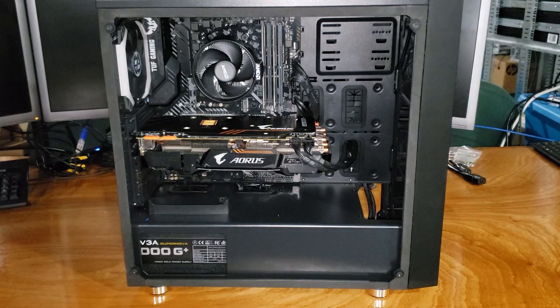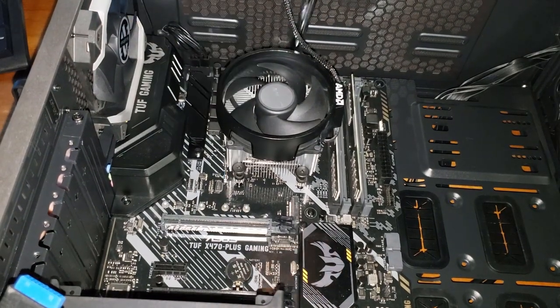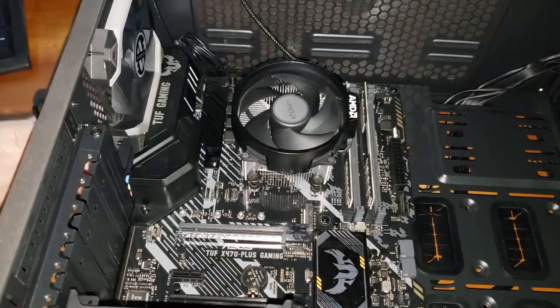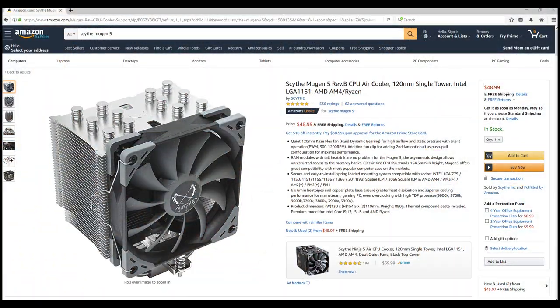I found the one included fan to be okay for overall system cooling, but probably not enough in a situation where the graphics card or processor has low-end coolers. I ran the first set of tests with my Ryzen 1600 AE at stock speeds with the stock cooler, landing around 74 to 77 degrees Celsius during a 3DMark Time Spy run. This is roughly where I'd expect temperatures to be, but slightly on the higher side given the ambient temperature of about 20°C. After switching to a Scythe Mugen 5, I saw a temperature reduction of about 10 to 15°C, down into the 60°C range.